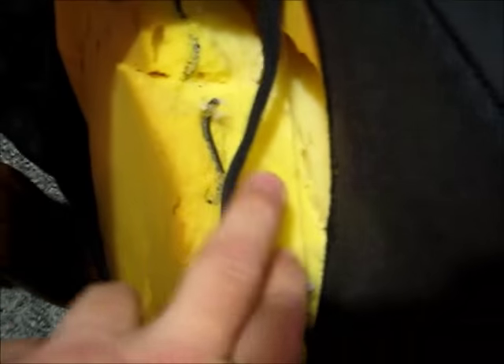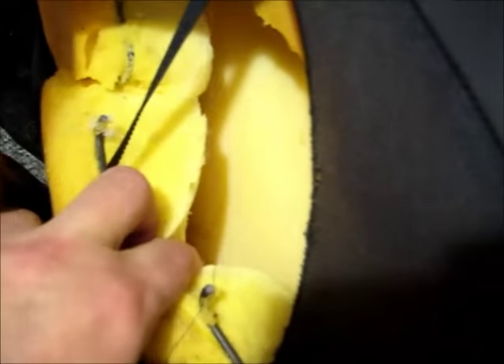This is a Stressless chair where the seat cushion has to be replaced, and I'm going to show you how to do that. What you start off doing is take the chair and put it on its side. You can see that the cushion is messed up on the bottom. So we're going to get that out and put a new one in. We've got to pop these off, unzip that, and detach the back — there are two spots on one side and two on the other.